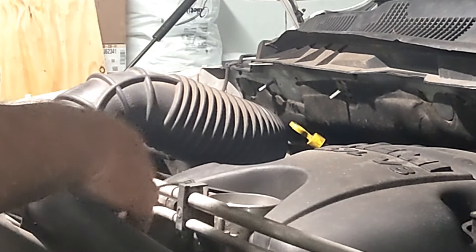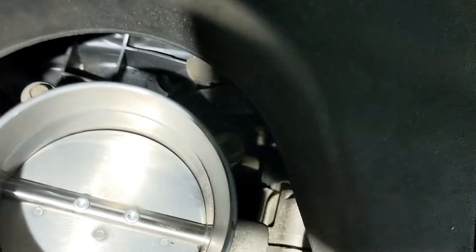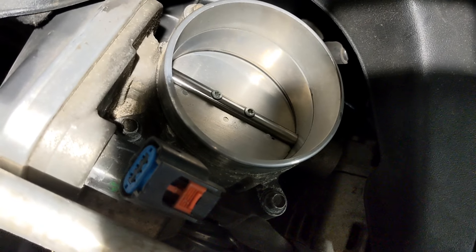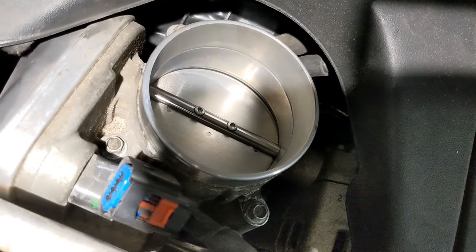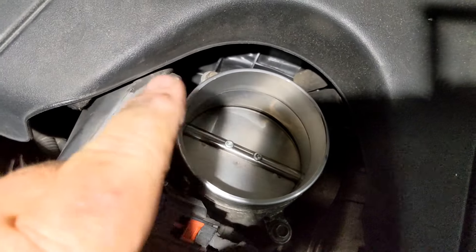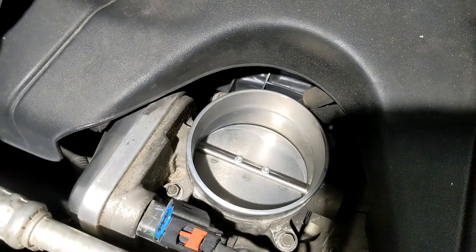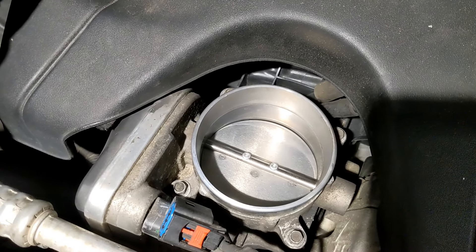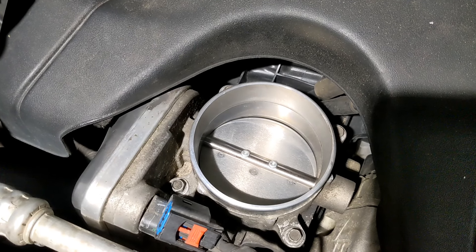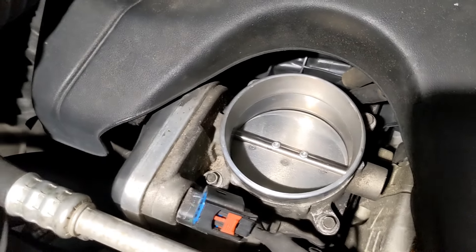That thing's as clean as a whistle. Here's the throttle body. Some guys say you can't push these in when they're not plugged in, but you can — it doesn't hurt anything. It's clean as a whistle in there because we just put a new intake manifold on this truck about three months ago. If you want to clean this throttle valve, there are four 8-millimeter bolts that bolt this onto the intake. Simply clean it out with throttle body cleaner and a toothbrush, both sides, inside and out. Bolt the four bolts back on and be careful not to get anything in your intake.